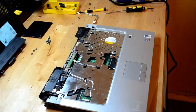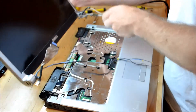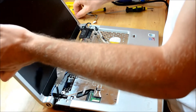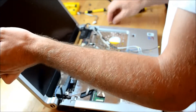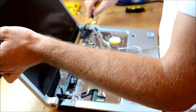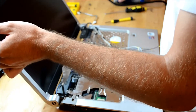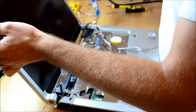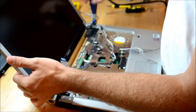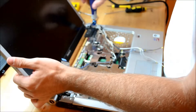The next part we're going to put in is the LCD. The LCD is pretty easy — you just kind of put it down into the two holes like this. Make sure nothing is catching. Then you're going to get the two largest screws and put those down in here. Be very sure that you're using the correct size screwdriver, because these ones require more torque to get down. If you've got a tiny little screwdriver, you're going to strip it out and then you're not going to have a laptop.